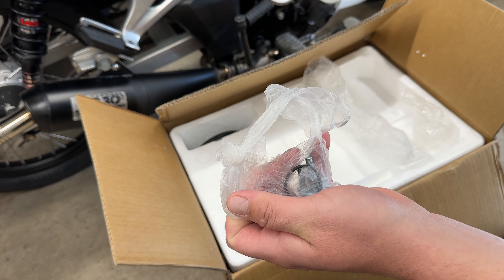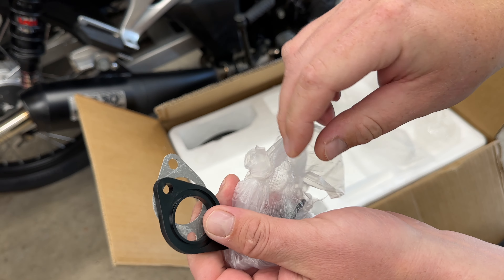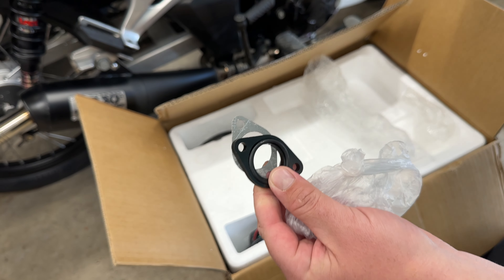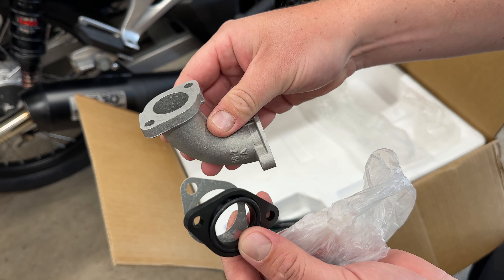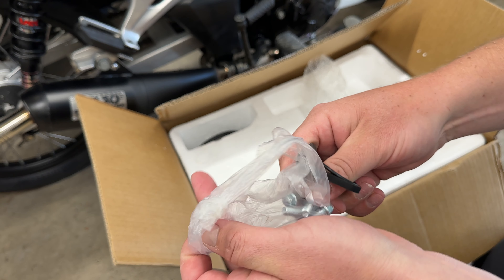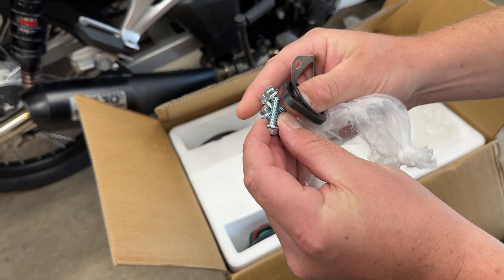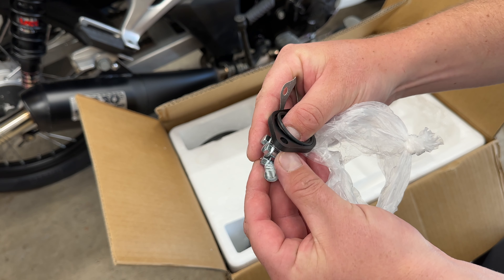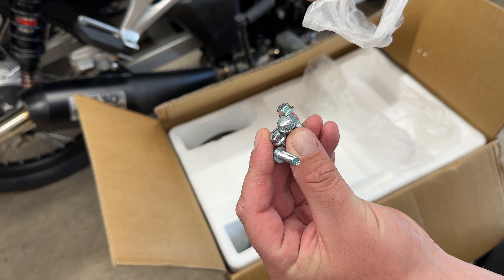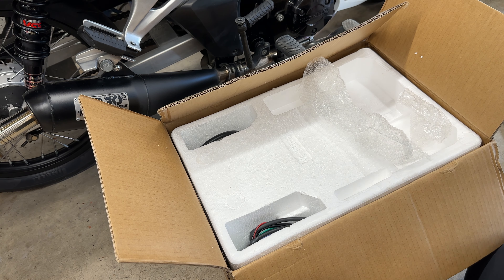You've got your fibre gasket, or kind of paper/cardboard gasket. You've got your plastic heat sink with a rubber o-ring, and you put this in between the carburetor and the manifold, because that will soak up a lot of the heat that goes through into the carburetor — that just makes things a lot better. In here you've got a few bolts as well: two short, one too long, and they will be for mounting the manifold into the motor and the carburetor onto here.